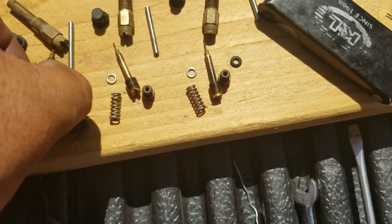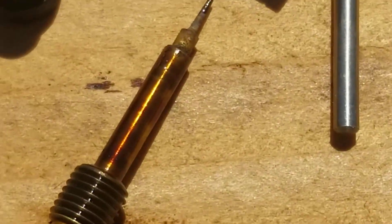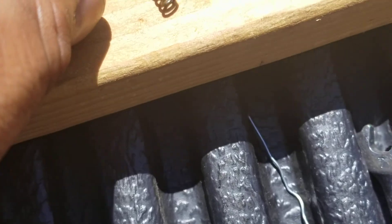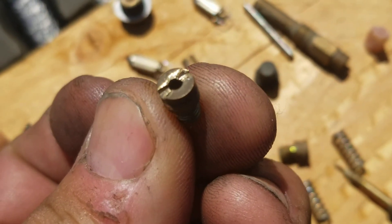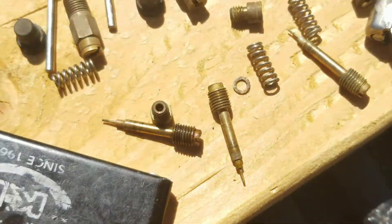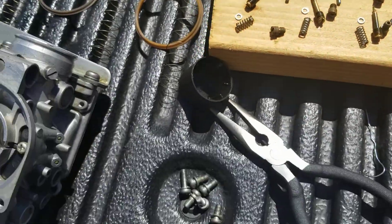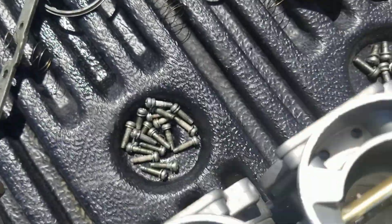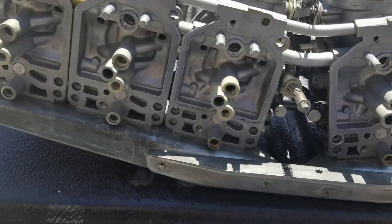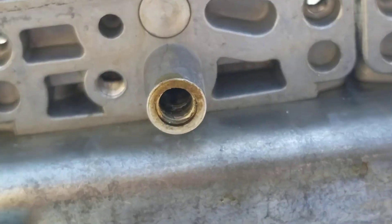As you can see, that's not clean and it's not new. You'll find a lot of these caps — that one's been capped — and definitely not new. Usually you get a new brass fitting. It looks like he may have put in new seat filters, but the carburetor was definitely in a dirty state, so I had to clean all that up. The mixture holes were dirty.